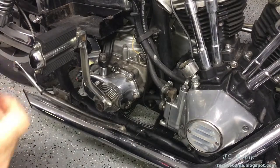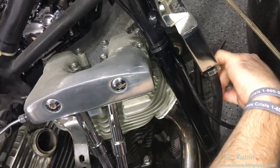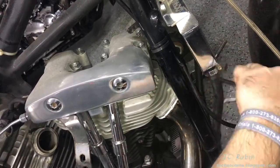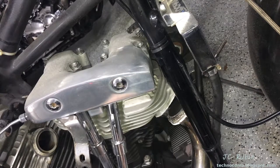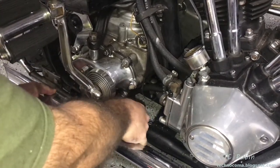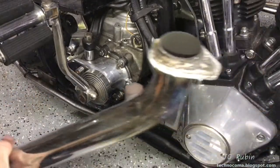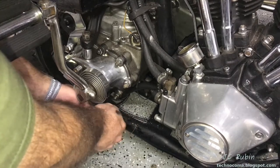I'll get just enough play and then go to the front bolt, which is back here under the oil cooler — it's 7/16s. I'll remove that; it's hard to see in camera but it's way under here. I'll support the pipe as I remove it. There we go, it's out. Now I'll pull off the rear bolt, take off the whole pipe, and put the bracket hardware back so they don't get lost. That concludes the exhaust system.